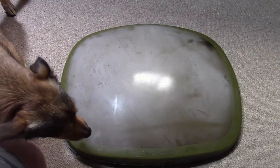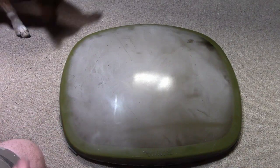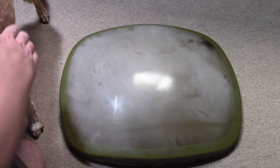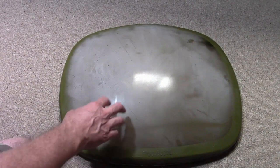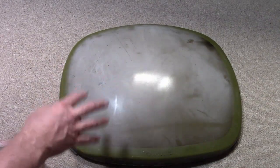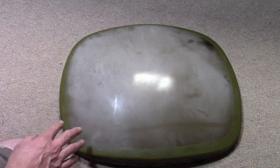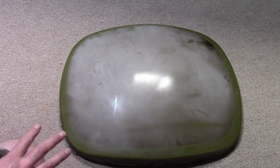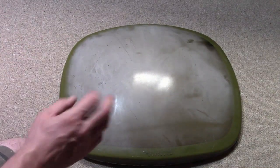One technique I know a lot of guys use is headlight polishing kits, especially if the cover is really bad. My one caution on that is the kit I've tried — the 3M kit — the coarsest grit is way too aggressive. The plastic used on headlight covers is really hard, tough stuff; this is not that hard. Let's say it's 220-grit sandpaper equivalent — it's really too aggressive unless you've got some deep scratches or flaws you want to sand out. For a cover that's just cloudy, I would skip the first few steps of those kits.